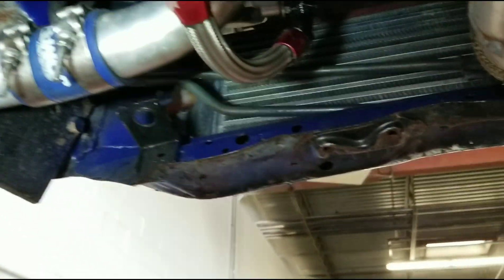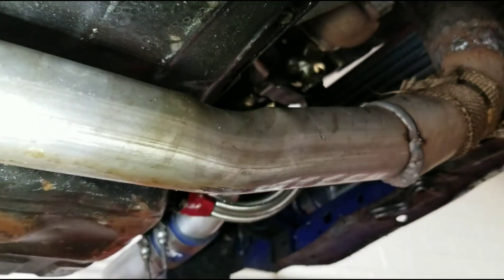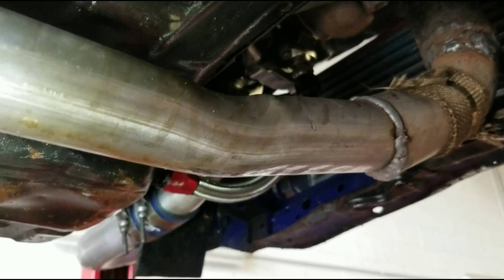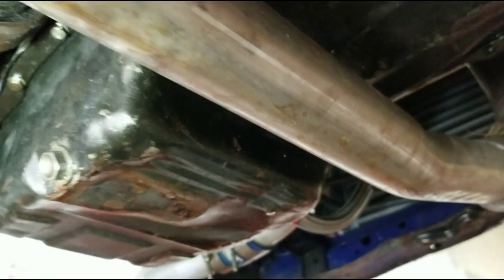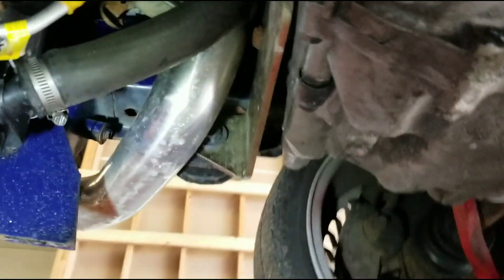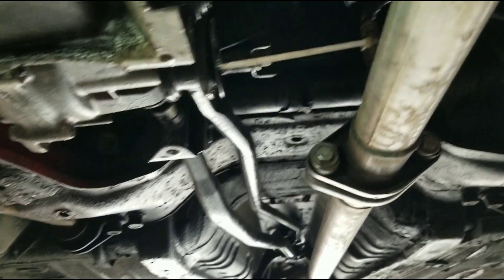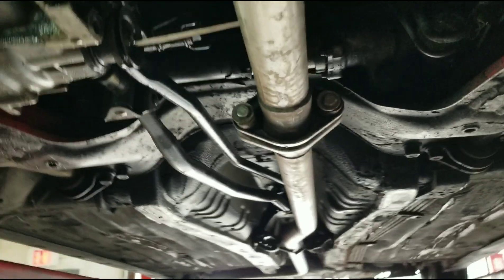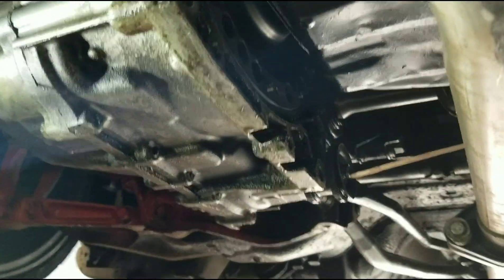There are more oil leaks. Looking at the turbo return line, looks like we've got some leaks up there. The downpipe is tiny too — very tiny. He's not shooting for high numbers, he wants very conservative numbers — about 270 to 290-ish — so we'll see what we can hit. This is basically a once-over that we do, we don't charge for this. My big thing is safety and making sure the tune is good, and being able to tell the customer they could have made more power if their exhaust was bigger.